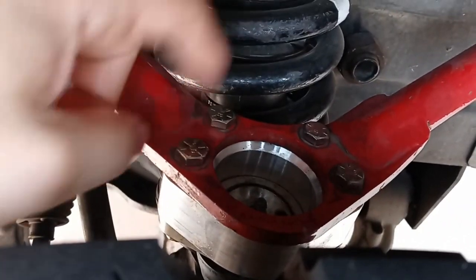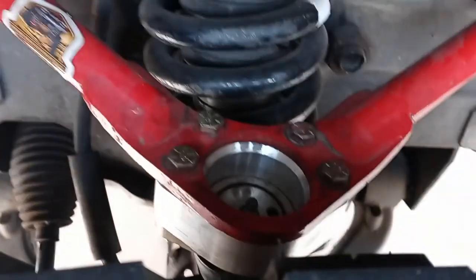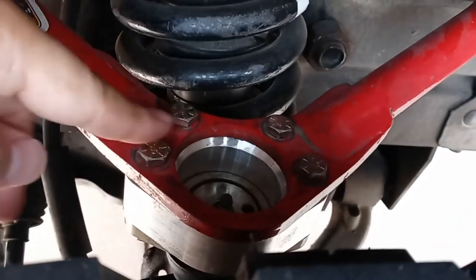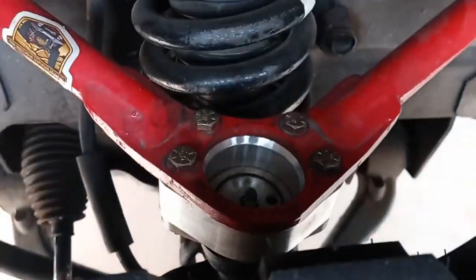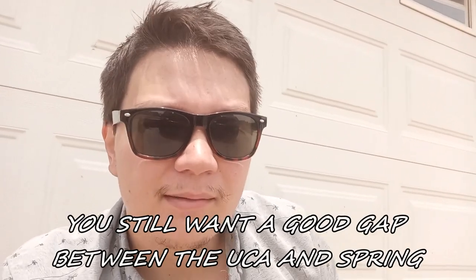Like I said in my last video, these are grade 8. If you haven't seen that last video, go ahead and check that out — it'll show you exactly what bolts you're going to want to use. These are the stock nuts that came with the JBA. With these upper control arm spacers I really think they're a good buy. If your upper control arm is still pushing that tire out, you just need to go higher — if you're at a three inch lift and it's doing it, just go a bit higher, it'll bring the upper control arm down.